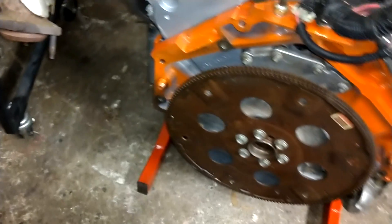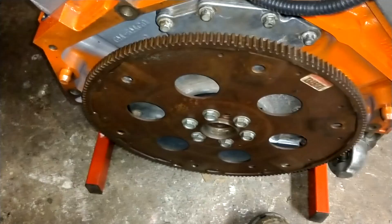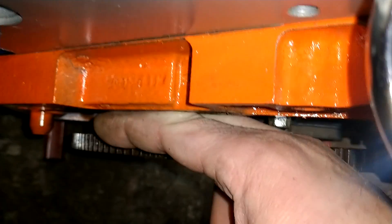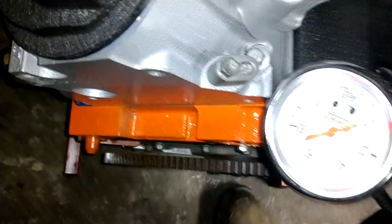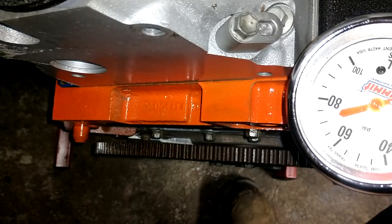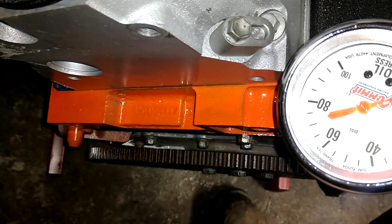Back to the comparison: you saw that's a dished flex plate. This is an early long crankshaft — if you look in here you've got more space; I can fit my fingers between the flex plate and the block, whereas on this one I cannot. We're talking a quarter inch, maybe three-eighths of an inch more clearance. This is a flat flex plate. Early 4.8s and early 6-liters had a longer crankshaft with a flat flex plate so they could use a 4L80 behind it versus a 4L60.